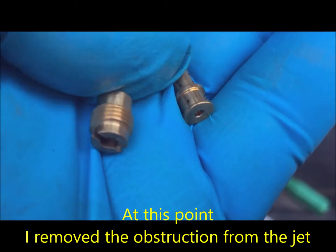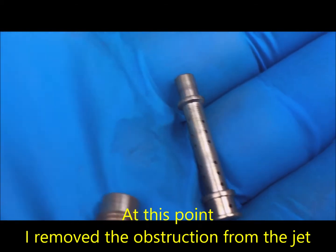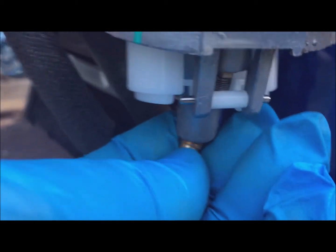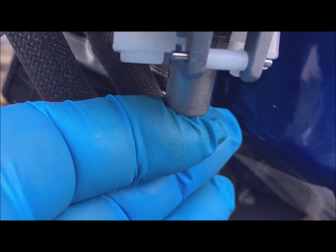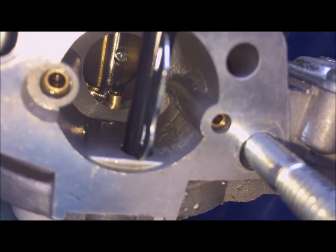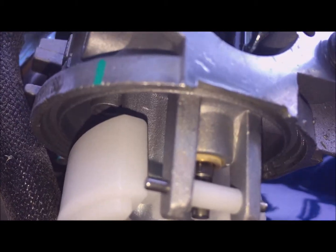These are the two main jet parts. It takes a straight blade screwdriver to unscrew the main jet, which is on the left, and the distribution tube that fits up into the carburetor falls out behind it. Make sure you put it in with the small end up. Notice the slots go to the bottom — it's going to fall out as soon as I let go, so I'm going to put the screwdriver up in there to hold it. You can just see the tip of that tube through the throat of the carburetor; that's why it's important to put the narrow end up.